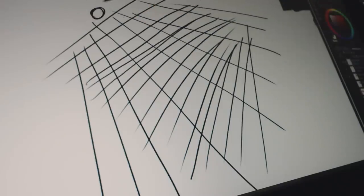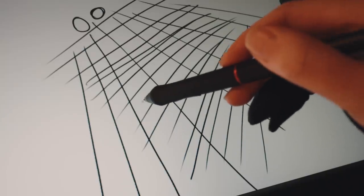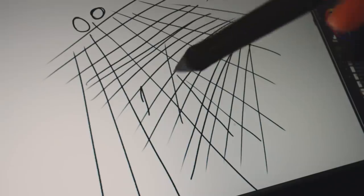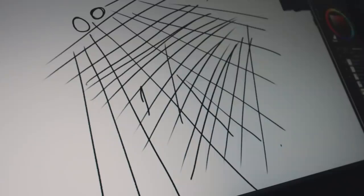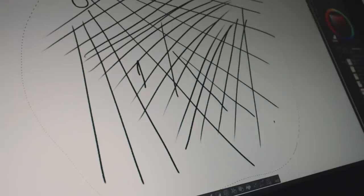Some people asked about the parallax. It's slightly noticeable, but I don't necessarily think that's a bad thing — with these types of devices you're often doing highly detailed work and you need to see your cursor to know what brush stroke you're going to make. At first the parallax was really noticeable for me, but I went into the pen settings and calibrated it. You can adjust the precision based on how you're viewing the tablet. In the pen settings there's a calibration tab — you hit calibration and it gives you dots that you hit to your best ability, and it calibrates the pen based on that, which helps minimize the parallax. I personally don't find it an issue. If you're super used to an iPad Pro that might take a while to adjust to, but otherwise you should be fine.